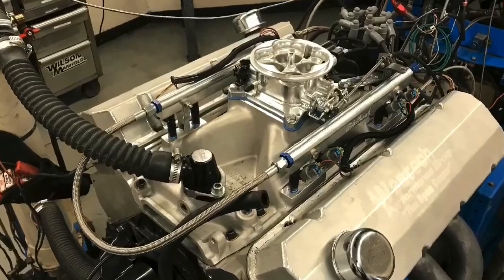In this video, I ran a pair of eBay DNA GT45 turbos on our big block Chevy, the Gen 6 454. Now previously I'd run a single turbo. If you haven't seen that video, check it out. It's right here. Predictably, one of these turbos was a little small for the 454. Back pressure was pretty high. So what do you do to cure back pressure on your big block? How about add two? And they only cost us 326 bucks for both.